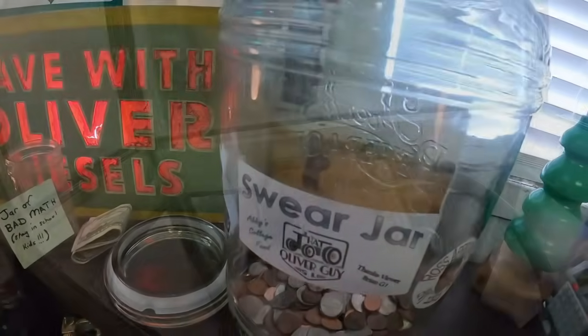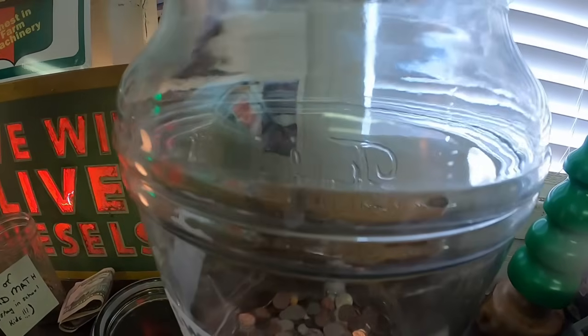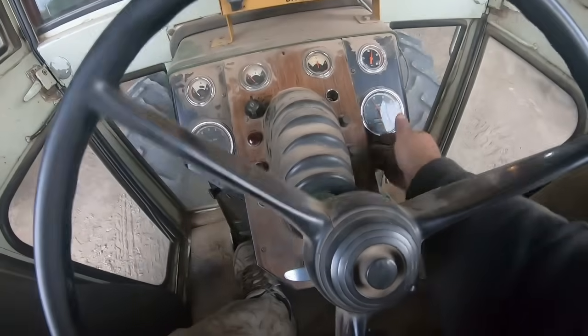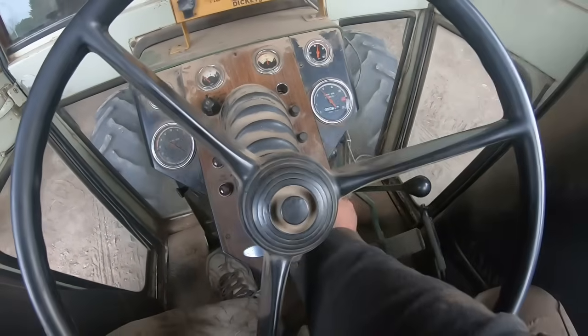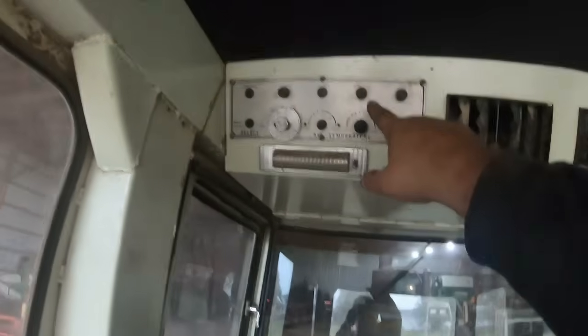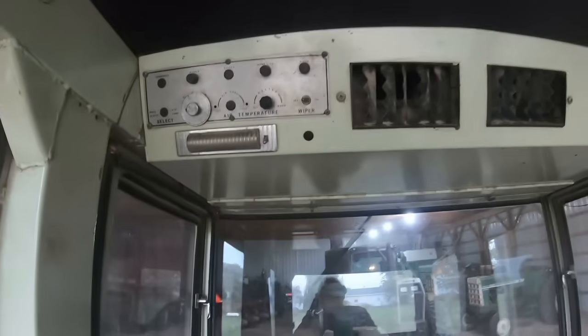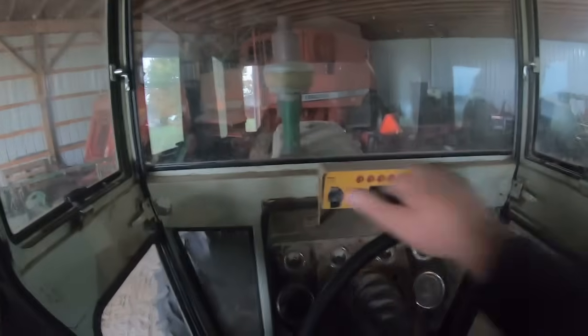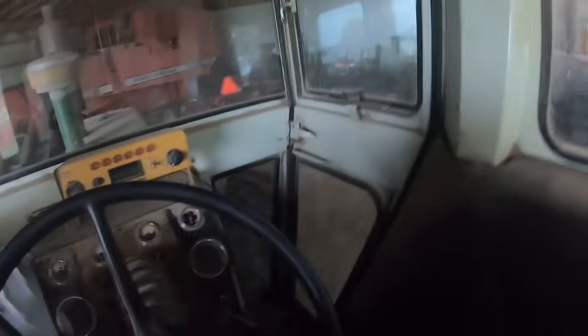It's all right, 1955. We'll get you better. Yep. We've got lights, instruments, and then there's fuses up here for the wiper, the blower, dome light. So yep, I bet you dollars to donuts. And that wire would be not part of the harness since the cab was an option. So it's probably wandering around in there a little looser than the other wires.